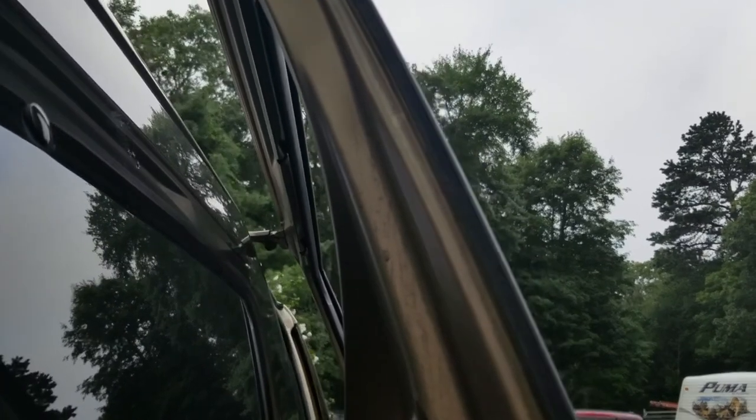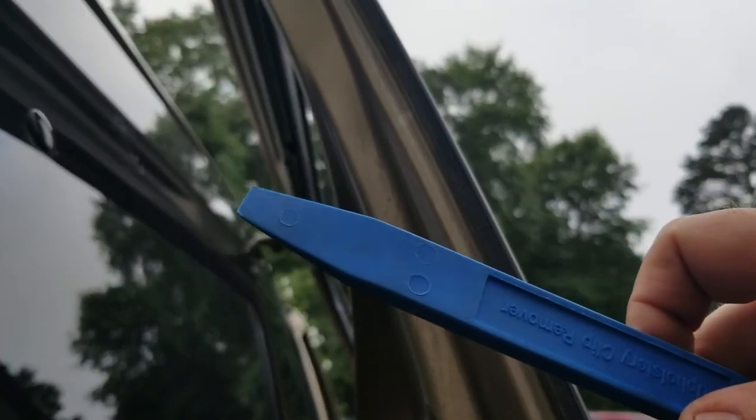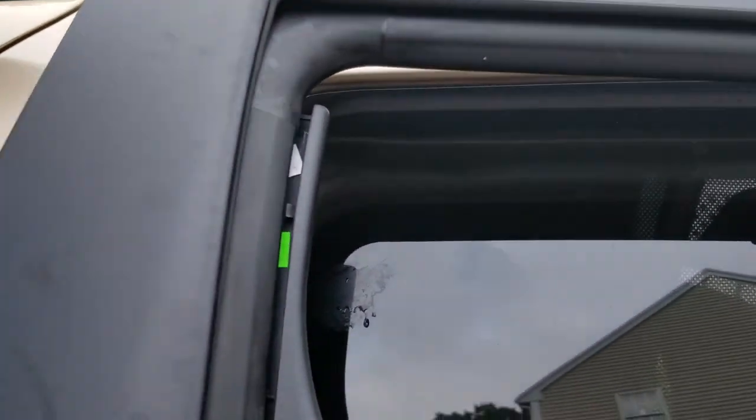Since we've got this panel now loose, there's probably something retaining this trim piece at the top, so we're going to investigate that. I've been able to access it through the back side while the door is open. Just follow this edge all the way up to the top where that trim piece is, take this part of the trim removal tool, and wedge it in. Now you can see there's a separation — this piece is loose from that top section. Just give it a little pull, nice and easy. You can tell that piece is now loose, and that clip is right there. Use the trim removal tool to aid in the removal of that little piece.